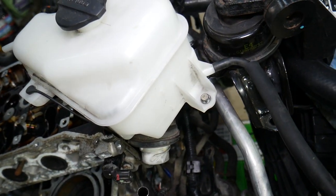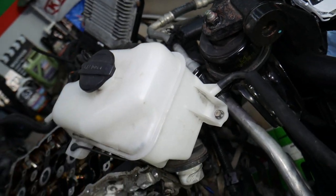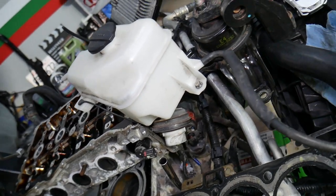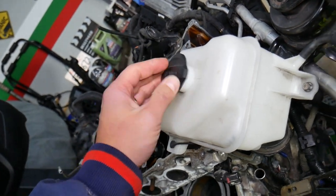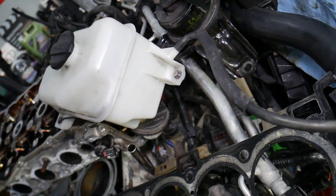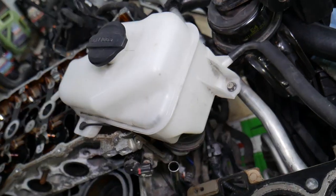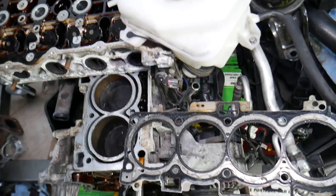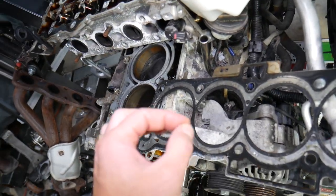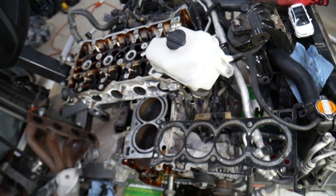From there it will bubble and come all the way to the coolant tank, so you will start putting exhaust gas into the coolant. Sometimes when you open it, you can even kind of smell exhaust gas in the coolant — this is because of a blown head gasket. Never open the radiator when it's hot. Usually the coolant overflow bottle is designed so you can open it and look, but always wear eye protection because things can go wrong and it can suddenly splash and burn you badly. You can usually see bubbles coming out when the head gasket is going out. If you want to see how to replace the head gasket on a Hyundai Santa Fe or learn all the symptoms of a bad head gasket, we have a video on the channel — please check it out. Hopefully this video was helpful. Thank you for watching and see you guys next time.